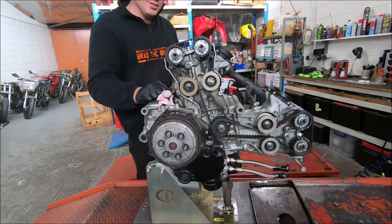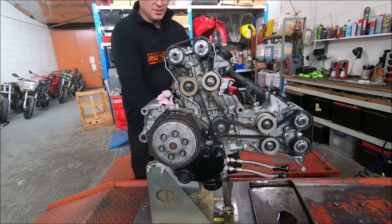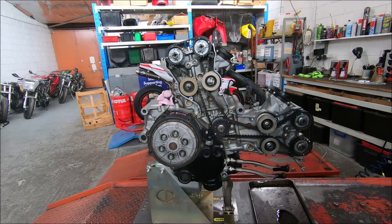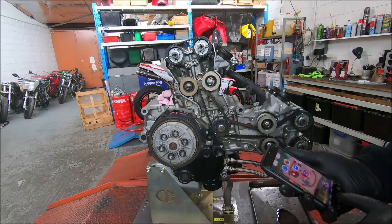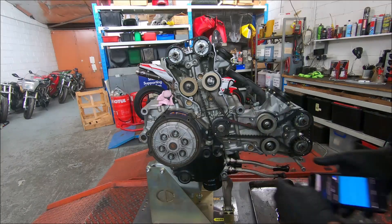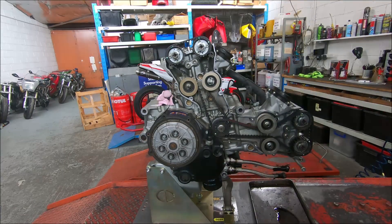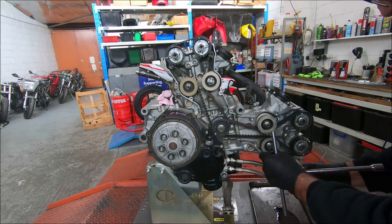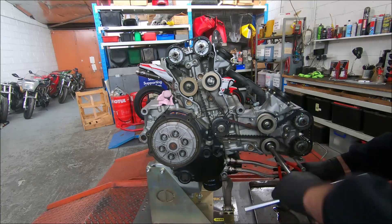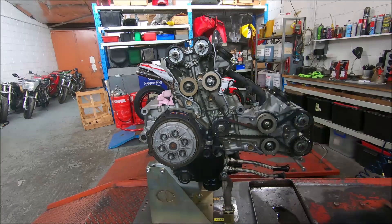Okay, made it around once. Give it quite a few turns — it sort of settles the belts down. Go back to top dead centre horizontal, and then I can check the belt tension. I'll try the Gates Carbon Drive app. I'll back that off a little bit, just aiming for 110 Hz. Getting 110 there — we'll turn it over though.